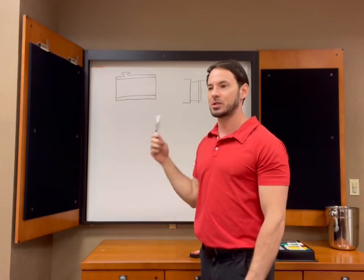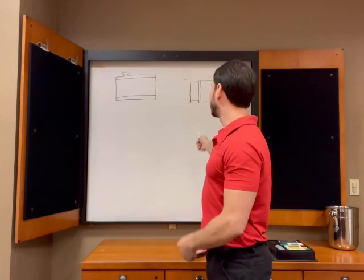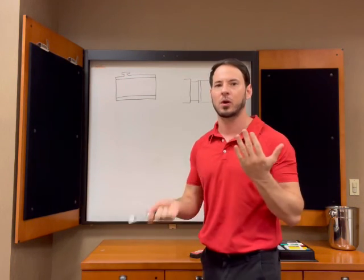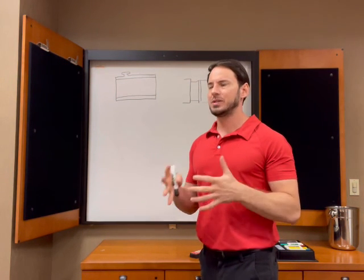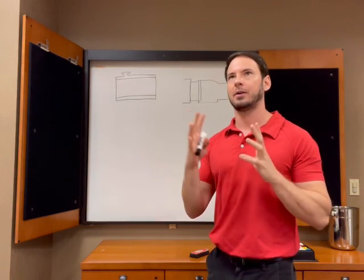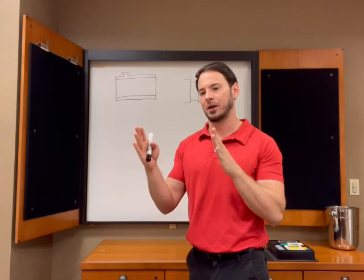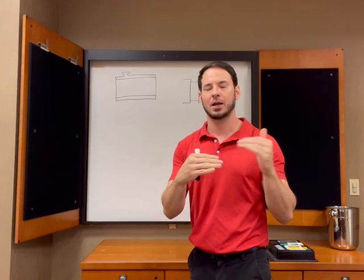Okay, so we've got potentially a lot of heat that could be generated because we have a high horsepower engine. We've got a relatively low final drive in here and we've only got four gears. Right, so basically when we look at a four-speed transmission, it's not enough gears, so basically you have four wrong choices. So due to the nature of a torque converter, we're going to use that torque converter a lot when it's unlocked because that's going to give me a little bit of a variable ratio type effect. I'm going to get torque multiplication so that I can have first gear, but depending on my throttle, I have this range where the torque converter is operating and multiplying the torque.